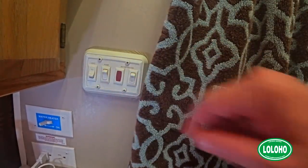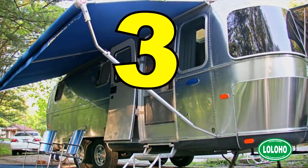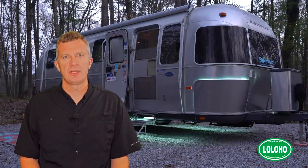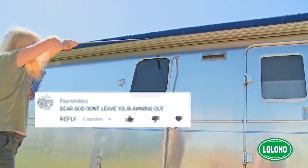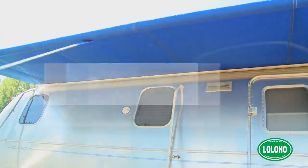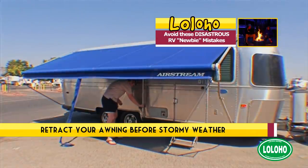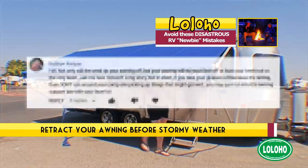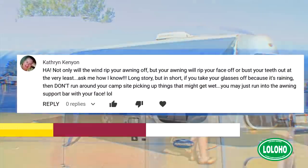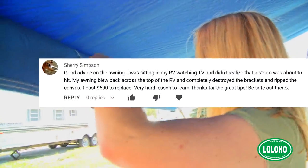Just make sure you have that water pump off anytime the RV is in motion or unattended. And if you're super conservative, you can turn your city water off when you leave the campsite. Number three — awnings. A lot of people ask why we don't use our awning more often. We do use it, but the reason you don't see it out in many of our videos is that we never want to leave our campsite with the awning out if there is any hint of rain, thunderstorm, or wind. Awnings are kind of like big sails on sailboats — in a windstorm, that awning will get whipped around if it is open.